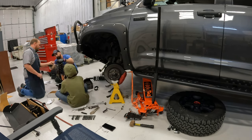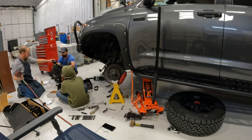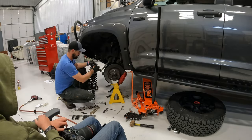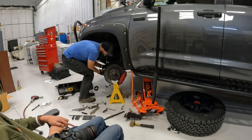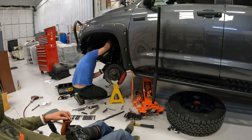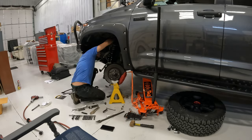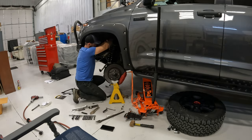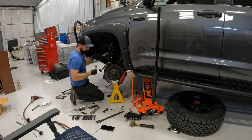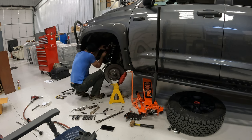A McPherson strut spring compression tool can be a sketchy thing to work with. You want to balance your spring load on each side. There are basically two pieces of all-thread that thread through two fingers that compress the spring — it's a little tricky to work with. You can see me step on the lower control arm to give room for the shock assembly. Once you figure out to do that, everything's pretty much a breeze. With the new shock assembly in place, it's pretty much just bolting everything back together following manufacturer's torque specs.